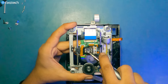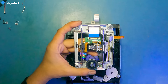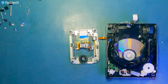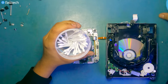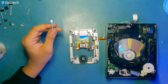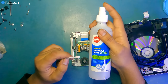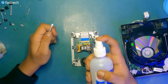Now, if you touch these lenses, you can damage them. You can definitely make them dirty, which also makes them not work. So if you have a dirty laser lens, which could also cause this thing to not read games, what you want to do is grab some Q-tips from fasttechstore.com, of course, and get some alcohol from fasttechstore.com. And I'm not talking Hennessy or rum. I'm talking about isopropyl alcohol, 70% specifically. Links in the description box.